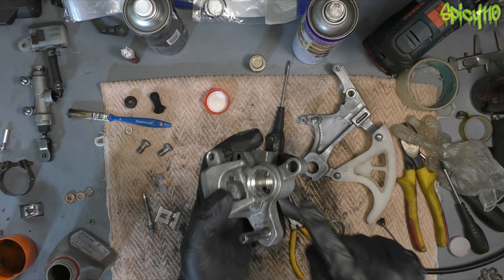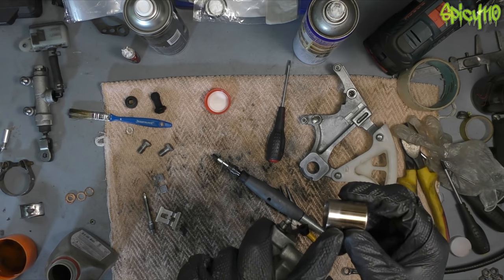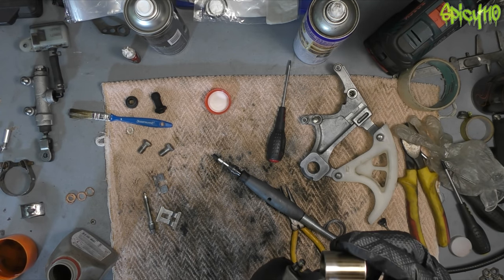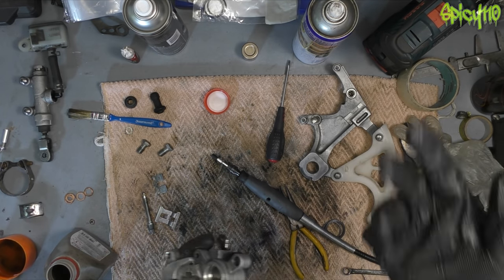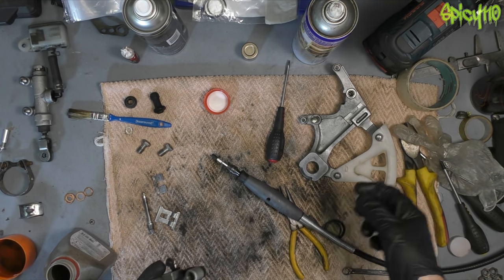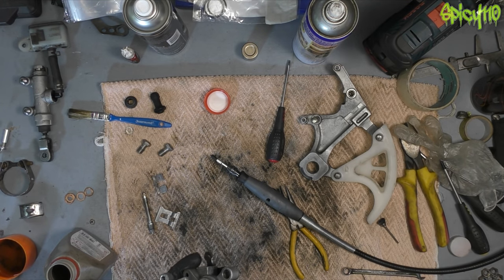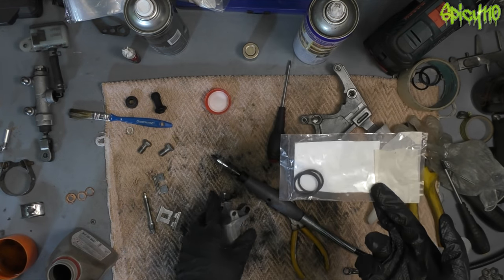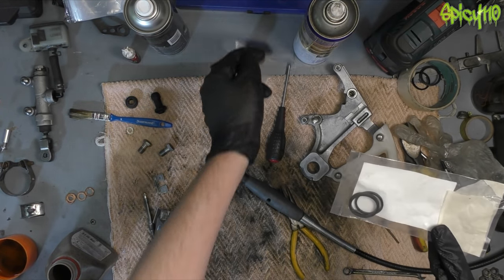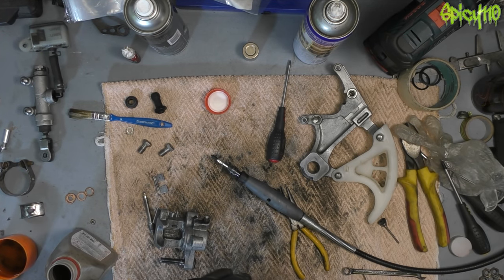This is the rear caliper — this was completely seized up. The pot's actually okay, I've cleaned that up best I can. There are a marginal couple of little pits, but it should be fine. It wasn't leaking before, it was just a bit seized. I've taken the seals out and they are gritty and a bit nasty. By absolute luck, I just so happen to have what I think is a set of seals — I actually have a set of front seals and a set of rear seals that was in my box of random stuff for the DRZ.